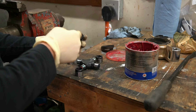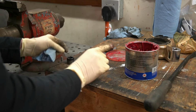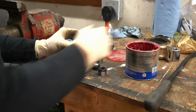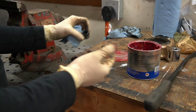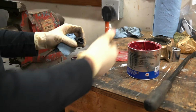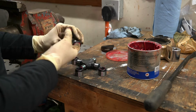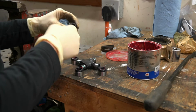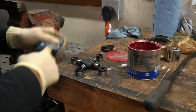It's actually just going to help and make your life a whole lot easier so you don't end up having a pin fold over, and then you won't be able to get your U-joint assembled. If you do have a pin fold over and say you break one and have to take it back apart, if you still have your old U-joint here, you can salvage some pins from there and take a little screwdriver and get them back in place, have it good to go. But I recommend just doing good practice the first time around and not have to worry about that.